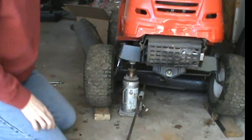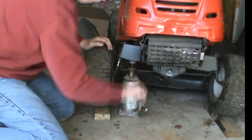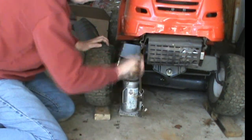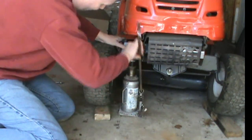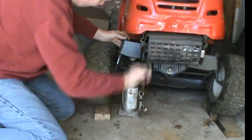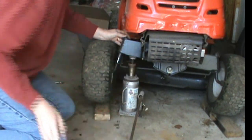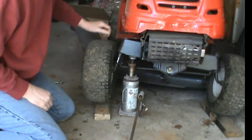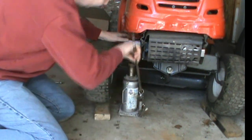See, now if I did this full time, I'd have a professional photographer doing this, but, you know. So you can see it's coming out here. So it'll get up to a point and it'll just drop out. At least that's the plan. So what I had to do is measure this part, make sure that this diameter was 3/4 of an inch or 19 millimeters, and to verify that those bearings would actually fit. That's what I did.